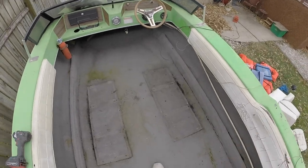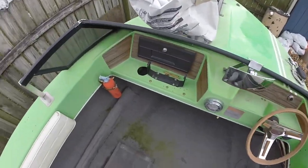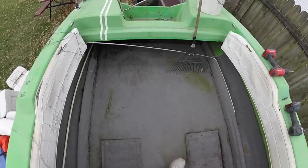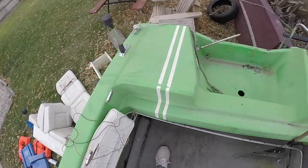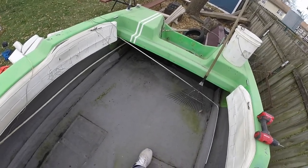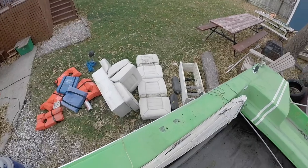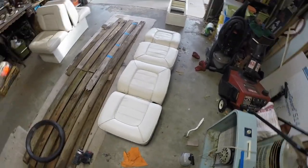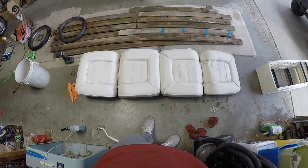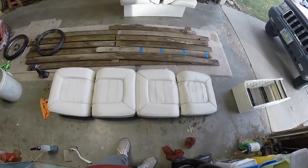So I got both seats out and vacuumed the majority of the gunk out of here, so now I can really see what I'm working with. I got a soft spot here, but when I peeled the carpet back it was pretty hard. I think I'm going to go ahead and replace about two foot wide going back from there. Now I'm going to try to scrub the seats down and see if I can get those any cleaner. You can probably tell the difference on camera — which side is cleaned and which side isn't — but I think the cleaned side is starting to look good.